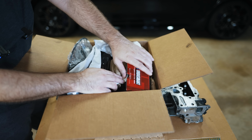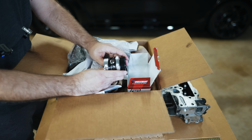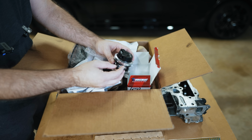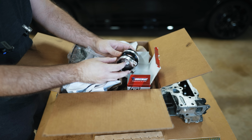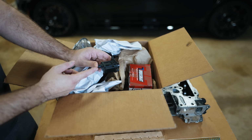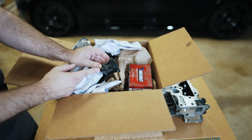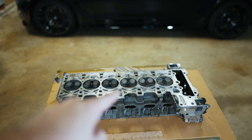If you want that sound, it's going to bolt to your charge pipe and work just like we described, where excess pressure gets pushed out the side here, you put your vacuum nipples here, and you connect your intake manifold, and you're back in 2007 when the N54 came out. And if you were to buy a blow-off valve for your N55, it would actually look like this, where it's electronically controlled. It's going to talk to the ECU. Why would you downgrade 10 plus years in terms of technology to get that sound?